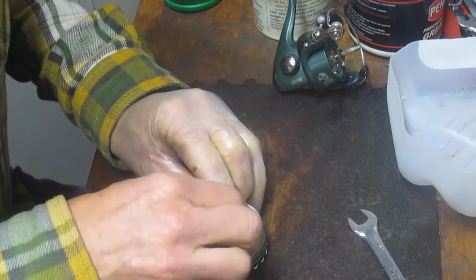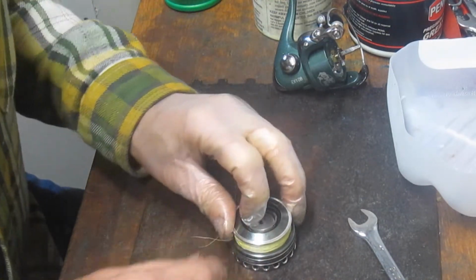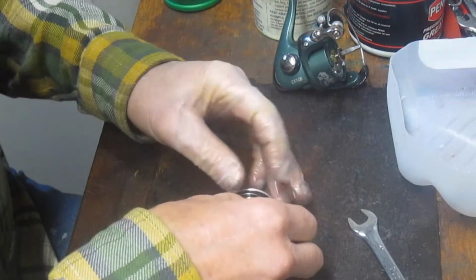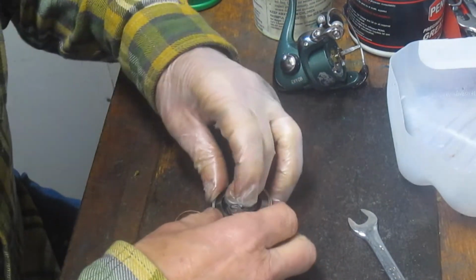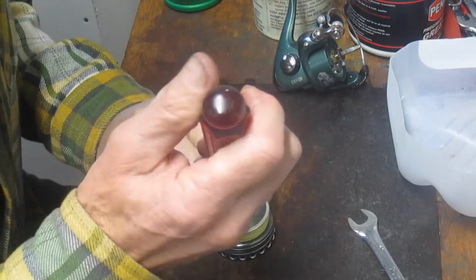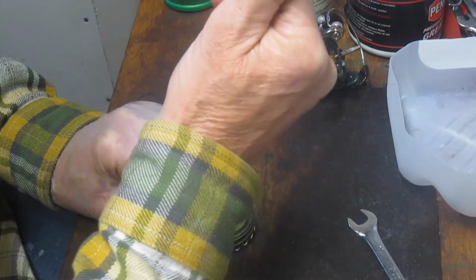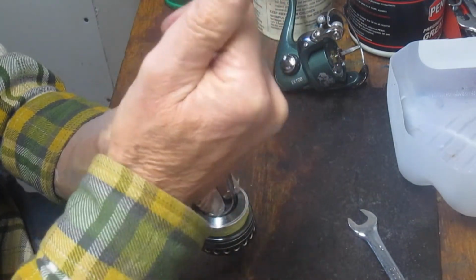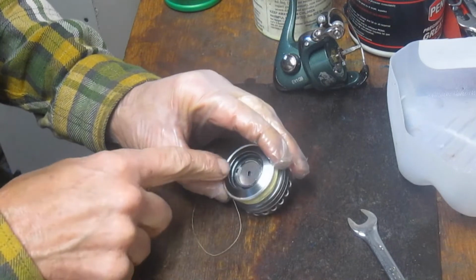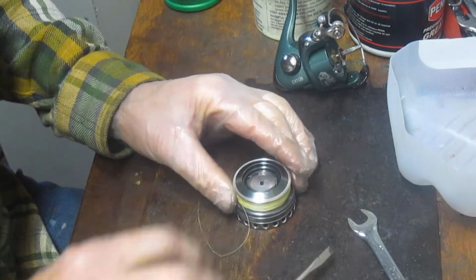And then this is always fun with these. You want to make sure that you seat the clip in the hole and then hold that clip because of the tension that's going to be on there. And then just a lot of hand strength is what's required. I like to walk it down with a screwdriver. And I'm sorry if you can't see this. Oops, I almost had it there, and then there we go. So I apologize if you weren't able to see that. So I anchored to one side, I braced the screwdriver against the lip of the other, and I just kind of kept walking it down till it pushed that in.